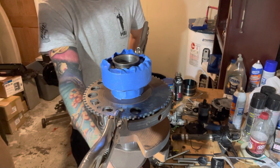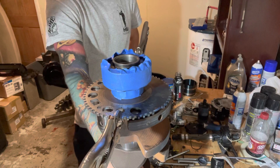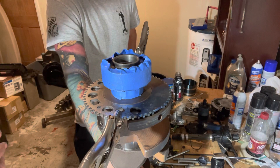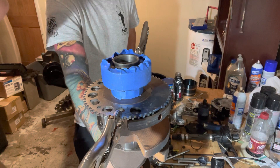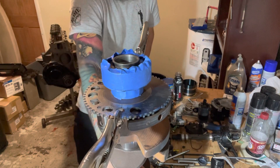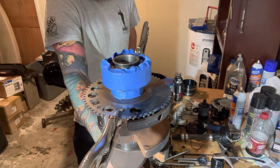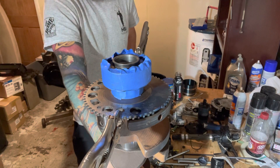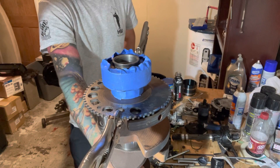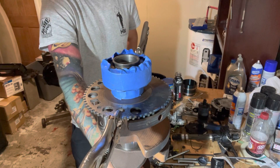Let me discuss why I'm doing the 58-tooth wheel. I have a 2009 GMC Sierra with a computer that needs the 58-tooth wheel. I'm putting in a 6-liter from approximately 2000-2001, which used a 24-tooth wheel, so I'm replacing it with a 58-tooth wheel. One of the keys to making it work is you have to disconnect the MAP sensor and let it run off the MAF sensor alone. Then it will compensate and run the 6-liter with the 5.3-liter software without having to change anything. I'll go into more detail in another video.